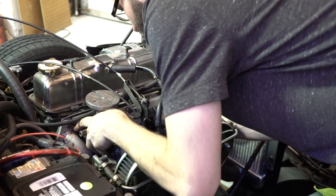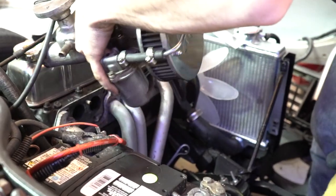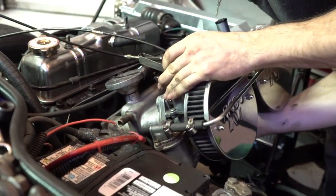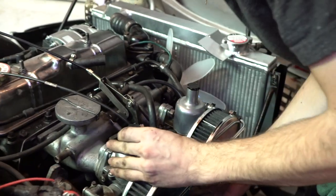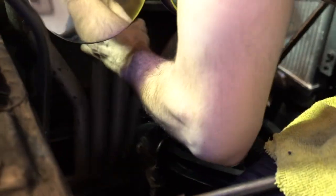The exhaust is still going to catch on this. The car also makes a good spot to chill and watch the work being done. So this will slide off — I don't have a place to put it, so I'm going to rest it on top of the valve cover and hold it with one hand while taking the exhaust manifold off together. The most important thing is we can get the headers out now.